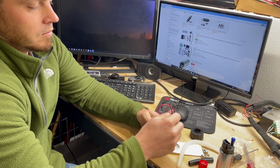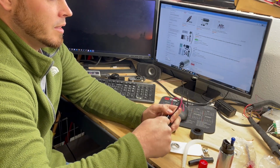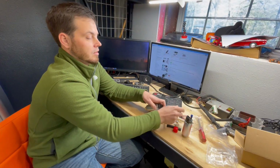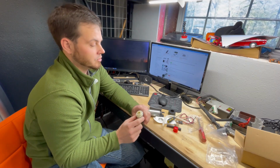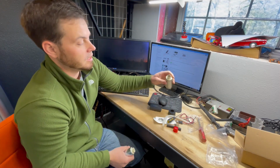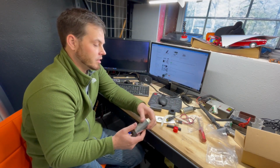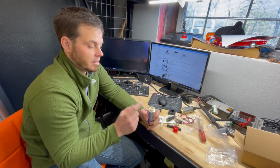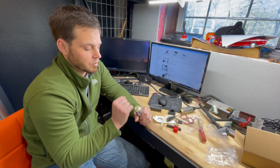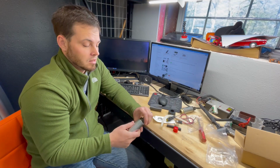So Blake, do you have experience in using a generic fuel pump? Yes, I do. One of the biggest problems with the generic fuel pump is the plastic gears and the lack of filtration. With this, you can see this actually has some trash in this screen, so this screen needs to be cleaned out a little bit. Even though it had a filter sock on it, things can tear, and debris can slip by. So any extra filtration is good. I've had these knockoffs where it'll suck up some grit or something. Maybe it was a fuel station with a contaminated underground tank, and it will just lodge into that plastic and lock it up in an instant. The fakes have left me on the side of the road before, and that's not fun.